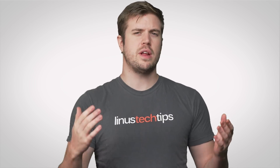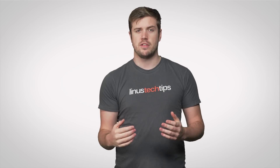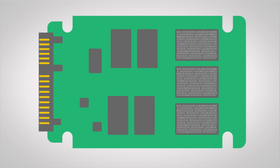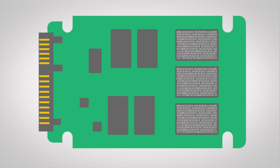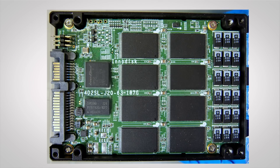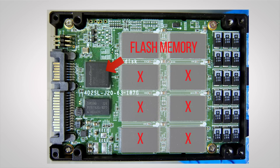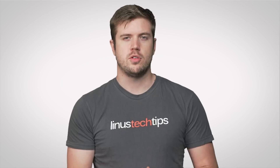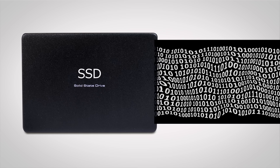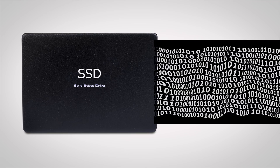This process of sorting your stuff in a storage container is very similar to what an SSD controller does. Just like a toolbox can't sort the tools itself, the flash cells on your SSD that store data need something that can fill them up sensibly with ones and zeros and talk to the rest of your computer. The SATA data connector on your SSD is wired directly into your SSD's controller, which processes the data and then sends it to your drive's flash memory. So because the controller is responsible for actually putting data onto the SSD, lower end ones can create a bottleneck or even be less reliable due to hardware and/or firmware differences.